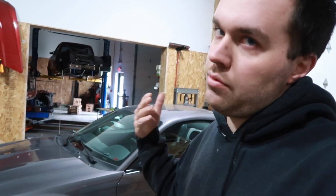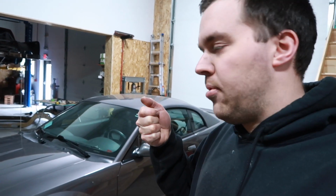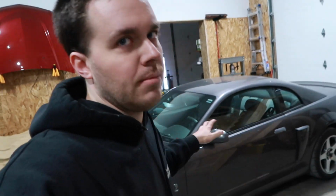I'm like, okay, no big deal. Dan realized that you probably got to pull up on the pedal, let it reset its adjustment, and that should give us some. So we hooked up the cable, we kind of forced it on so it would have preload against the pedal, popped the pedal up, which released the adjuster, and it got better, but wasn't perfect. In fact, it probably still would have worked.